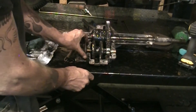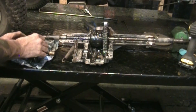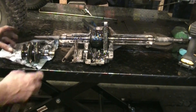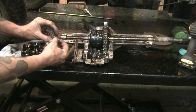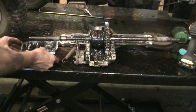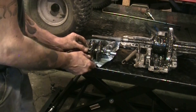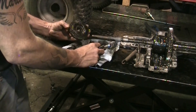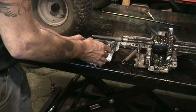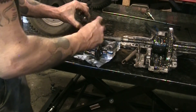Rolling it out — possibly stuck in the brake. Got the shaft out, pushing the grease back in. There's a bump on this bushing that has to be oriented properly when we put it back together. There's our brake rotor. Another bushing. This is our forward gear — it's quite rounded. I'm going to wipe that off and show you what I'm talking about. There's our slip collar — yeah, it's rounded too.